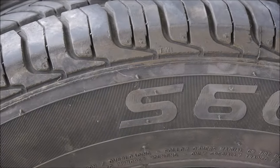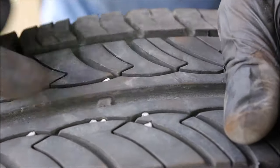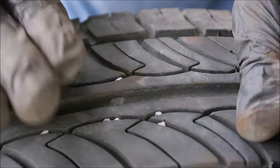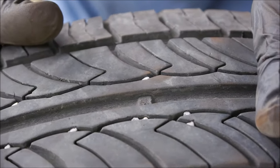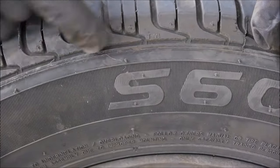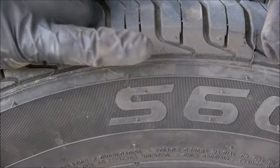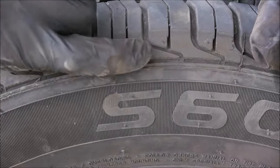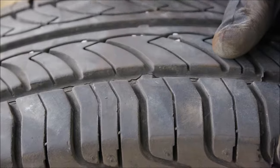It's likely that at speed the temperature, heat and pressure would build up and you'd have a blowout. Now you might not have a gauge to check the depth of your tyre, but you don't need that. Tyres in fact have these little lumps of rubber in the grooves, and that lump is at 1.6mm from the very surface. So once your tyre tread depth gets down to that lump, you know you are on the limit and you must be changing your tyres at the soonest opportunity. To find those little lumps in your tyre, if you look along the sidewall, you'll either find a little arrow or you'll find three letters: T.W.I. — Tread Wear Indicator. They'll have them probably five or six times around the circumference of the tyre, so you can follow in and find the lumps of rubber — that is your little gauge.